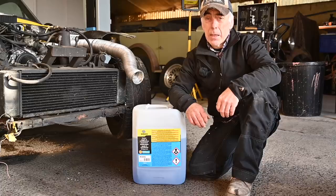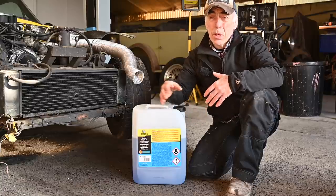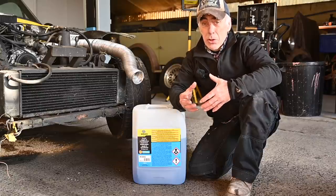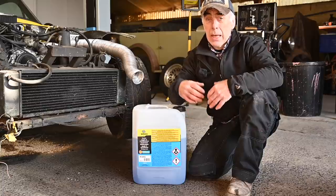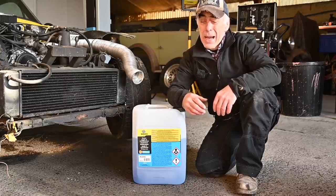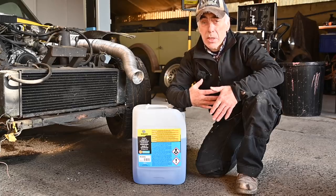Cooling liquids have changed over time. Around the year 2000, the use of distilled water with glycol was replaced by pre-prepared cooling liquids with different substances. You don't need to mix these with water — just pour them into the engine block. They cool very well, allow higher temperatures, protect against corrosion, and have a better cooling effect. The only problem with these newer products is that they create more pressure in the cooling system, so a 13 psi release cap might not be suitable anymore — you may want to fit a 16 psi cap.